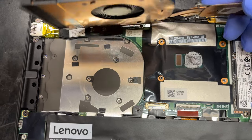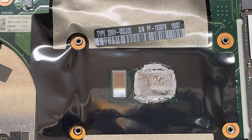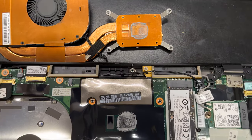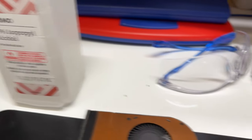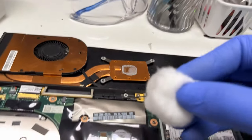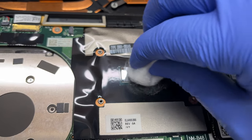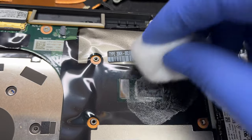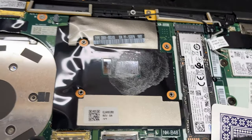Once we do that, we'll flip it over and you can see that this thing is in desperate need of new thermal paste. This is very old crusty thermal paste, which makes sense because this thing was getting to 100 degrees Celsius. To clean this, we're going to use some rubbing alcohol and some cotton balls. Just dampen your cotton ball with some alcohol and start gently scrubbing. It won't take much to get the thermal paste off of the CPU — it should just come right apart. As you can see, it turns into this milky nastiness. Take another cotton ball and just clean that up afterwards.